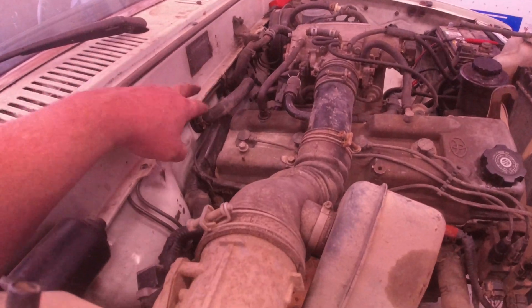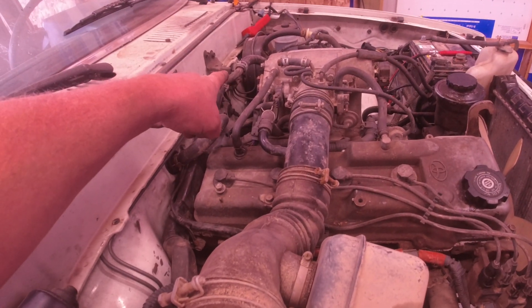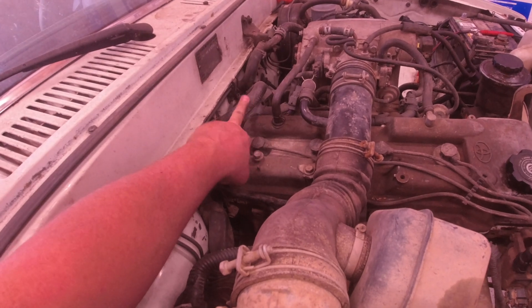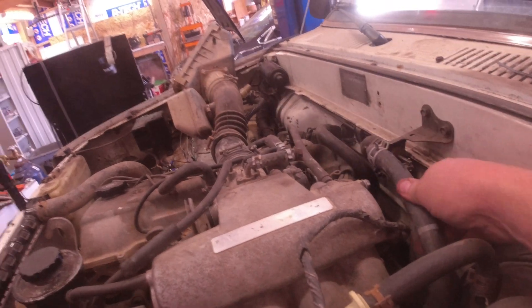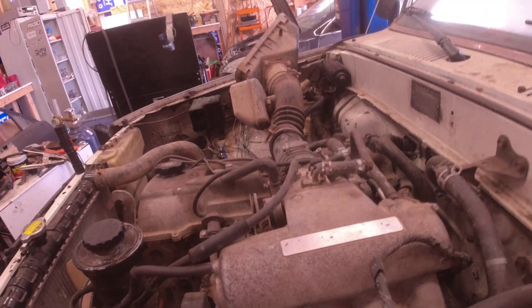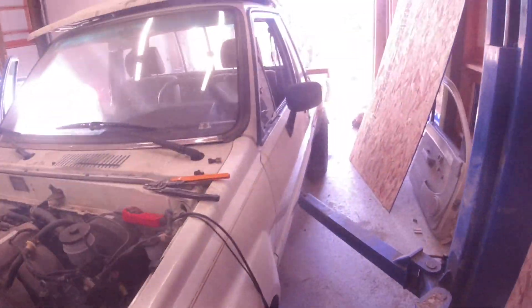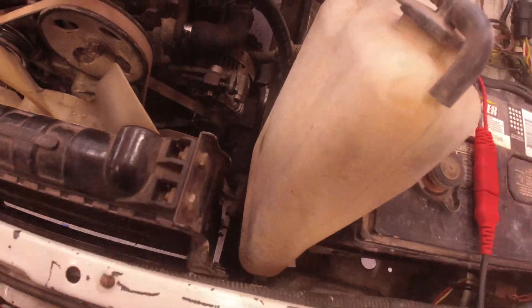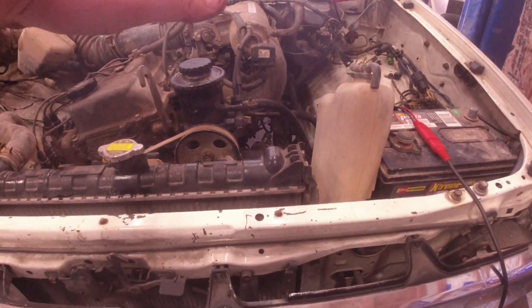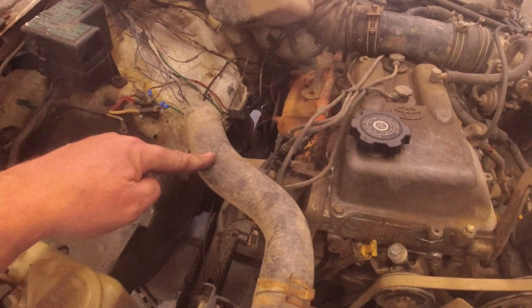As far as the cooling system goes, this was really straightforward. The heater hoses in the back are stock, so I used the '85 Toyota heater control valve. This hose came off the 4Runner with the 3RZ, and the other hose I believe also came off the 3RZ - I had to shorten it a little bit. The radiator is out of the '85, out of this truck. Unfortunately that radiator is just too tall and it won't fit down far enough - the frame won't allow it - so the radiator would end up sitting too high for the hood.